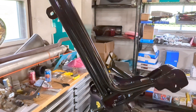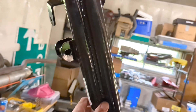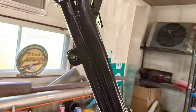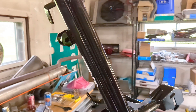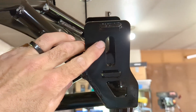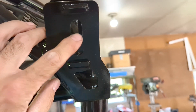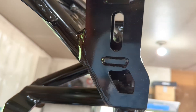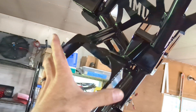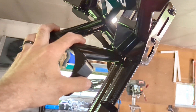Not as much as I thought, but savings nonetheless. So this is one of the big differences — this double tubular section here for the road race K-member. A lot of the other ones are just a single tube, which makes them lighter, but they don't have the strength we need for road racing. Another key difference is this right here — slotted tabs for the lower control arms, with plates that lock into place. Each plate has different locations for the A-arm mounting holes, so that allows you to adjust and dial things in. Another reason this one's a little bit heavier is it has the integrated motor mounts.